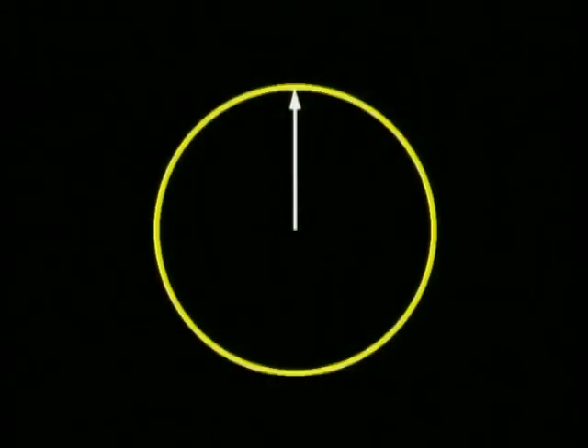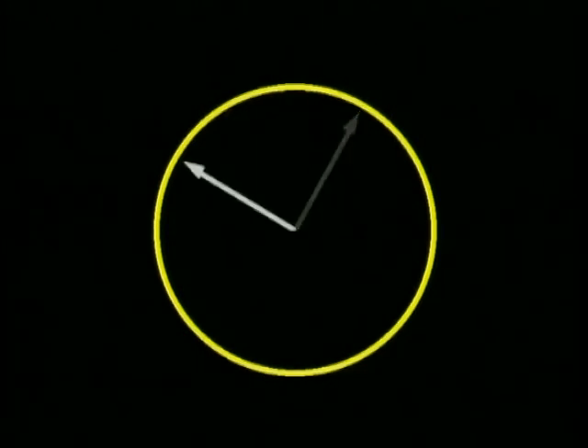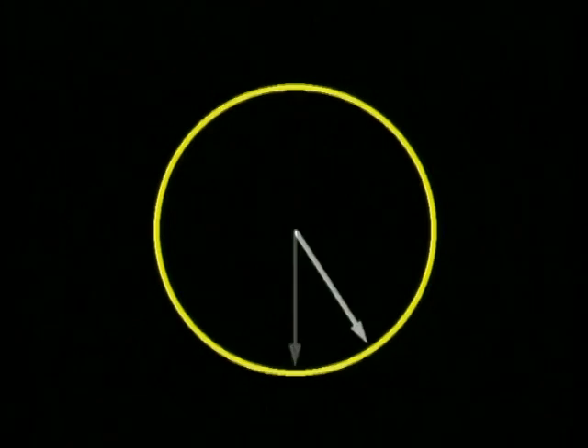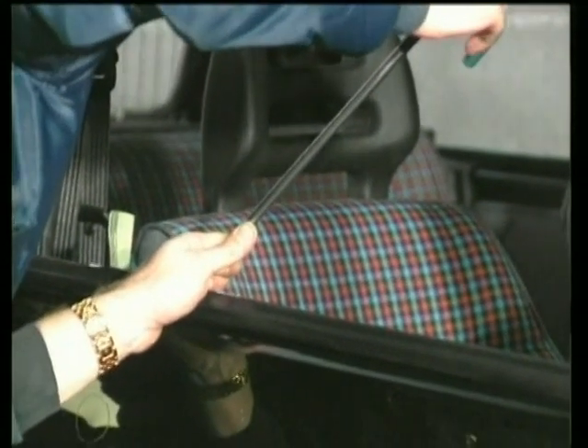We will start with removing a low. The plan is to work around the edge of the dent first, making the area of the dent smaller and smaller until it has all gone. To do this, we use the clock method. Imagine a clock face around the dent. Use the rod to push up at 12 o'clock, then 11, then 1, then 10, then 2. Start at the top at 12 o'clock, then progress to the middle. At this point, switch to 6 o'clock, then 5, then 7, finishing at 9 and 3. When you do it correctly, your last move will be to lift the center of the dent. Never let the shoulder of the dent get too steep, because the sharper the angle of the dent, the harder the metal is to straighten out.